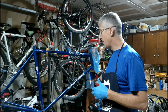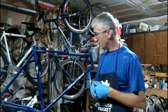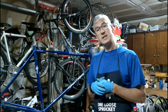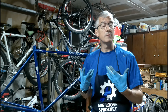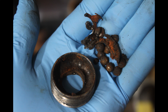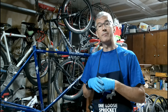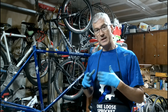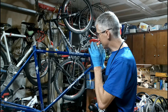I stripped this thing completely down to the frame. It's actually in pretty good condition — structurally sound, just quite dirty. The bottom bracket was caked with rust; water had probably come down through the seat tube and accumulated there. One of the bearing races had gotten chewed up badly, leaving the bearings rolling around with extra metal from the cage. Once I got that all out, it looked okay. I checked the cups carefully and now I'm down to the bare frame.